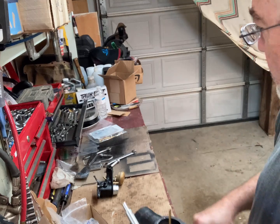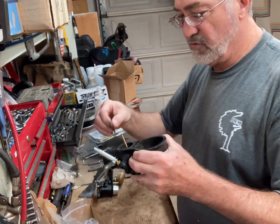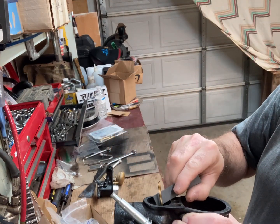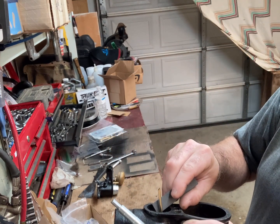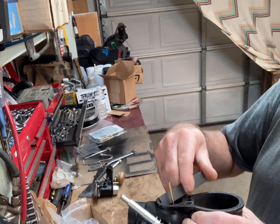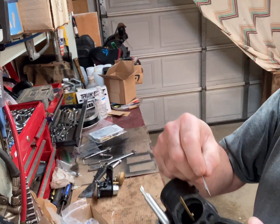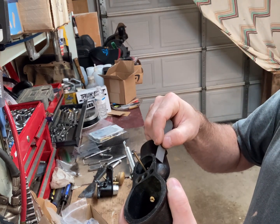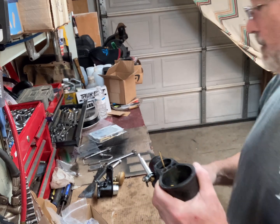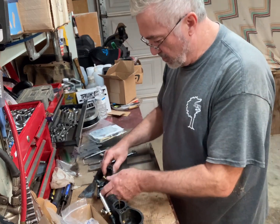I actually have a little device that measures 5/8". You can see if I put that on top of the surface right here, the fuel should be that much below. You don't have a whole lot of room with that jet. Let's continue on and check out the rest of this carburetor.